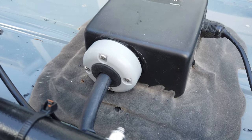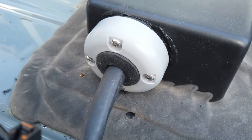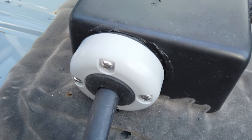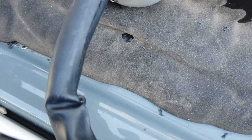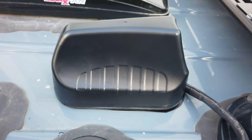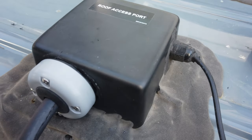As you can see, we've got the cable gland in. I ended up mounting it on the side and using a little bit of sealer behind the gasket, just because it was so hard to get to. Preferably I would have mounted it further back, but there were two mounting tabs in the way of a gland that large. It's not entirely perfect, but I think it's going to get the job done. I also found a hole up here that I'll probably need to take care of in the future. Routed the cable along here and up above. Also a little neoprene underneath the antenna. And — always pick up after yourself.